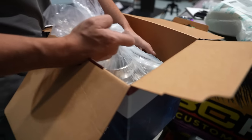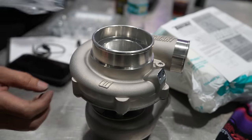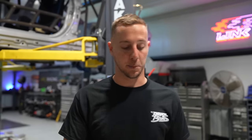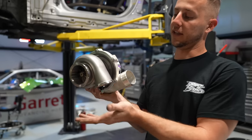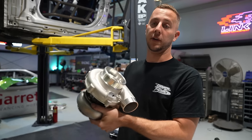Opening the box — look at the turbines in there. Double blades, double stacked. We saw the TurboSmart lineup at SEMA and have always used their blow-off valves and wastegates, but this is their new turbo design — they build the turbo around the engine rather than a horsepower goal. So it's optimized for turbo response, good spool, and efficiency. They come in V-band and T4 inlets, and our new Phase Manifold has the V-band inlet so we can clock the turbo however we want. We're going to line it up and give it a test run.